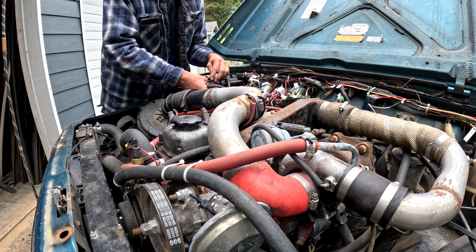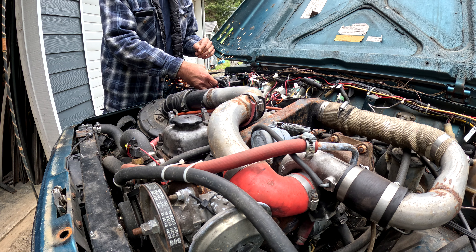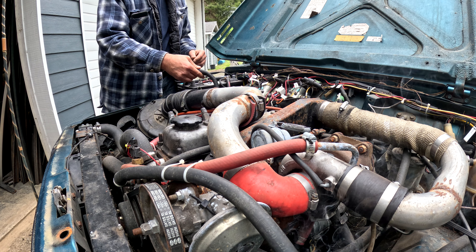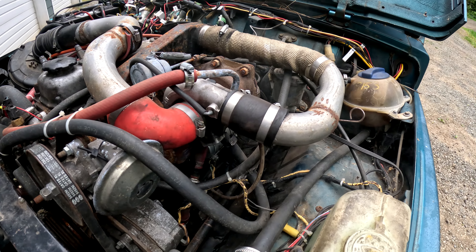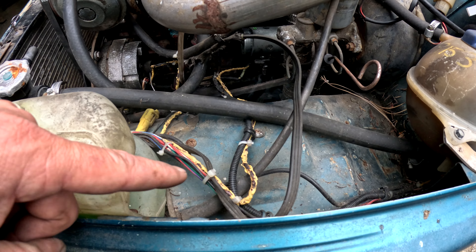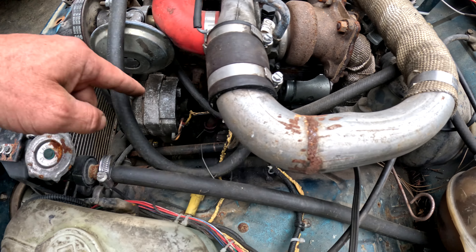Got my work cut out for me if I expect to drive this thing out in the desert for a week and a half from now. Let's back this trailer up and roll this thing off. This cable here goes to those winch lines I'm not going to be using. Holy cow — there's a lot of amperage there for some reason. Oh, there's smoke. It's that wire going to the alternator — this thing that was already smoked here. I really don't want to touch that, it's plenty hot. It looks like it's going from the starter down there to the alternator.